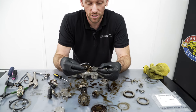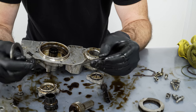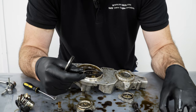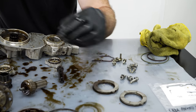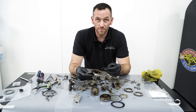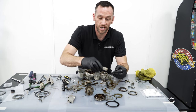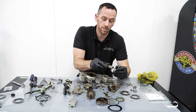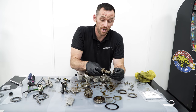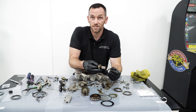Yep. There are S62 ones out there, but we've found that when you run a VANOS test or you put them on the dyno, they're slightly too tight. And the reaction time of the unit is a bit slow. So these are kind of a halfway house in between these ones, which wear out prematurely because they're not tight enough, and the S62, which is probably a bit too tight. Because it's basically putting too much pressure on the gears at that point. If there's too much tension, as the gear goes in and out and tries to rotate the cam, it's also rotating against the hub. And the tension is just a bit too tight, so the reaction time in and out slows down. Not an issue on a road car, but certainly on a race engine, you want the reaction time to be the fastest. Yeah, I can imagine once you've started lightening all the parts.